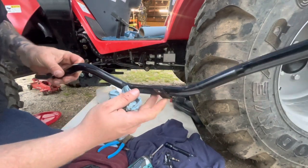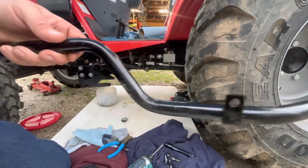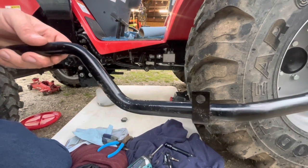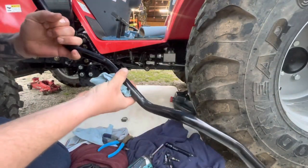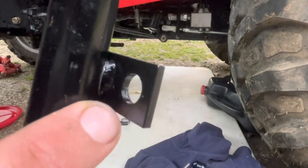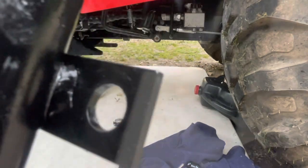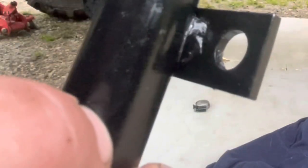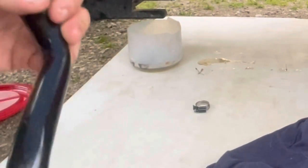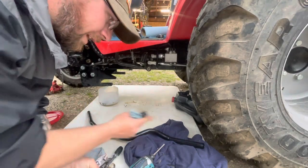This is the tab that I told you about. This is the tab that was holding it in the back — I took the bolt out. See right here where this tab is welded onto this pipe? I believe it's cracked right there, and that's allowing air to get into the hydraulic oil. I'm either going to get this repaired or have to replace the whole tube.